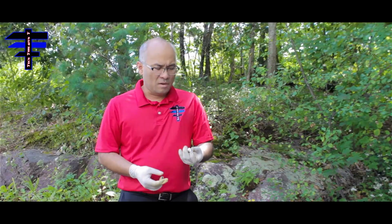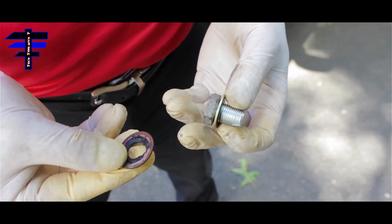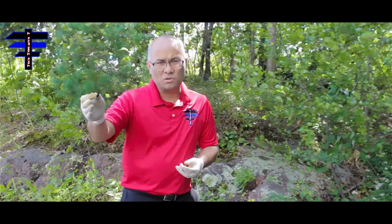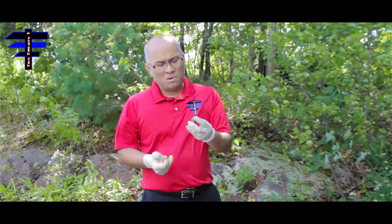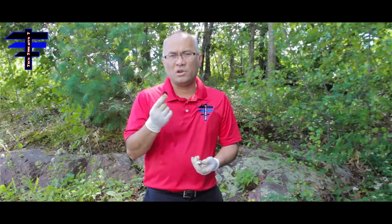Nice and clean. Then you put the drain plug back in. All right, guys. Before you put the drain plug back on, make sure you check if you have a washer for the drain plug. Sometimes it's stuck to the drain pan itself, or could be here. So you want to make sure you have one, or remove it, and also check if it's still good or not.